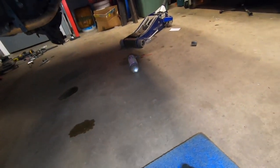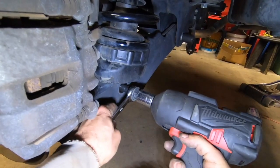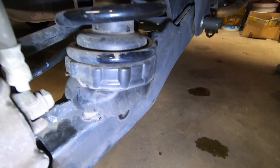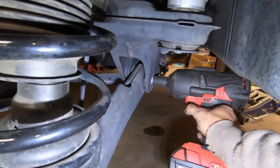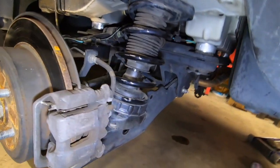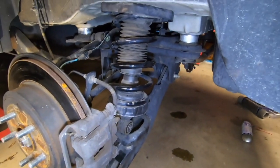Then take out the lower shock bolt — pretty easy, just pull it out. If it gets stuck, put a wrench on it and lever it out. The last bolt to do is the inner one, because that bushing actually holds the whole arm up and won't let it drop enough to get the strut out. Once you loosen that last bolt, you'll see the whole thing drop. To get it to come down the rest of the way, you can use a sledgehammer or just a pry bar — it's not that hard. Pop that down and it allows you to get the strut out much more easily.